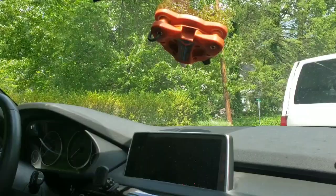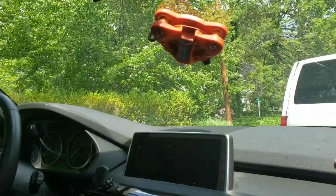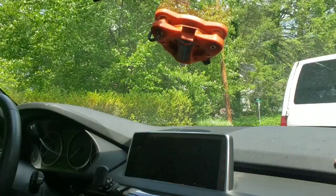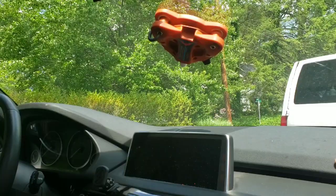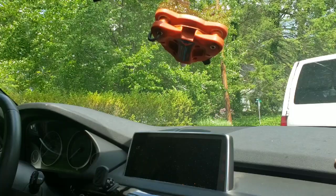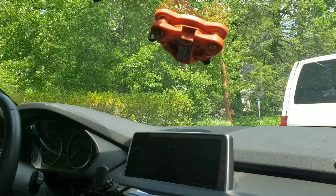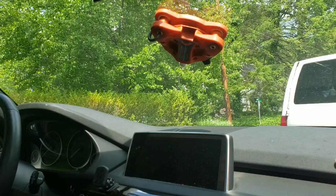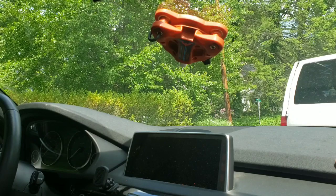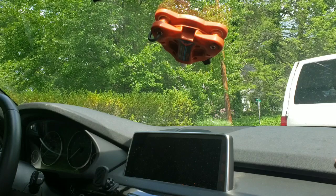Anyway, I hope this helps. This was a little video showing a new trick that I do — less movement, just more concentration on the line. If it makes the job faster, why not? Try it and let me know how it worked for you. But like I said, try it on German cars first — Audis, Volkswagens, BMWs — factory windshields, because they don't put a lot of urethane. Because if you work on a Ford F-150, there's going to be a little bit extra glue in there and it might rip the line.